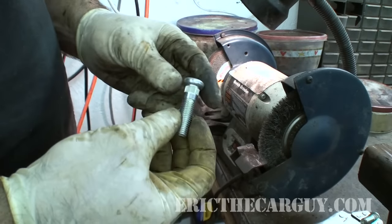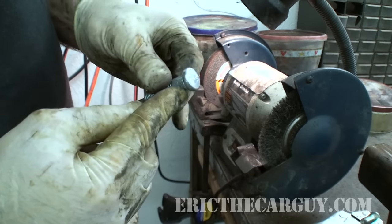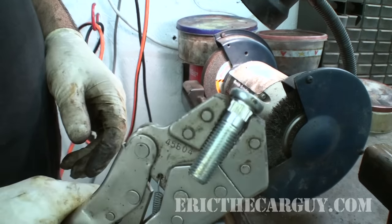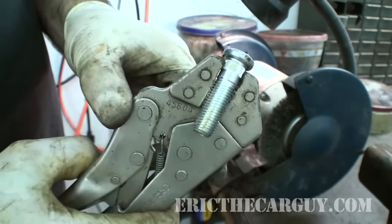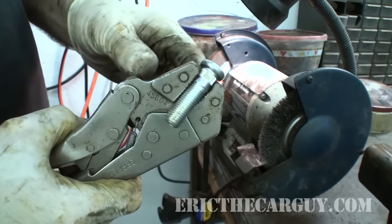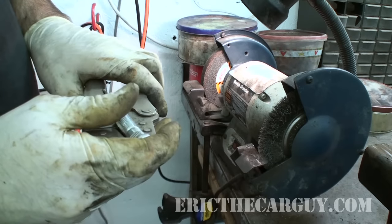As a measure of dealing with this issue, I am going to actually shave down part of this stud so that it slips into place. I'm going to have to shave down a good portion of this — more than some of you might be comfortable with, but that's what I've got to do. You'll notice I've positioned the stud inside my vice grips; I'm not touching the threads. You don't want to damage the threads — that's the whole reason why you're here in the first place. I'm going to shave off with this grinder as much of this stud as I possibly can and still have it be a viable stud.